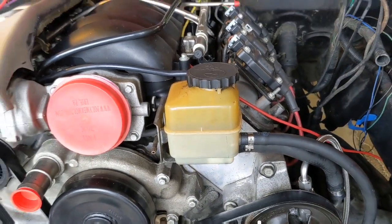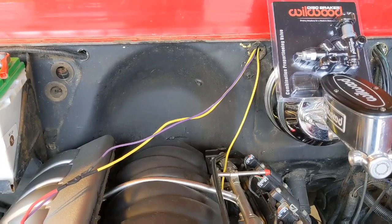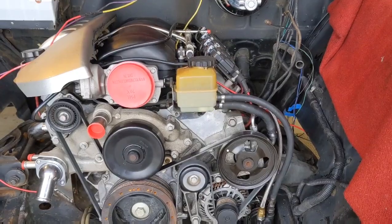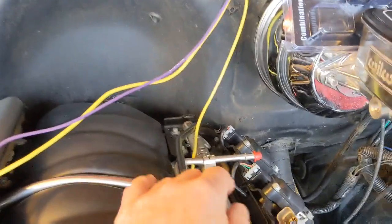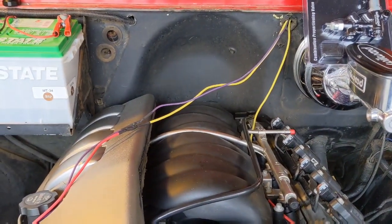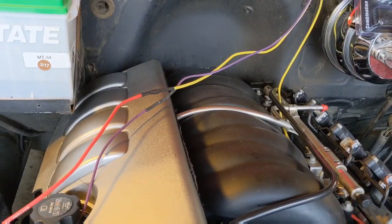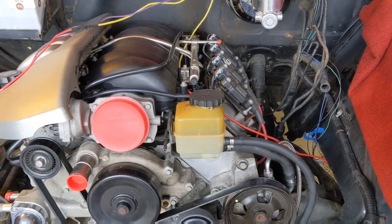We've rummaged through the wiring and you end up with two or three circuits. In this particular situation we have the starter on the passenger side and the alternator on the driver's side. Since we're using the Ron Francis wiring, they actually have two circuits — one for the alternator and one for the starter. They're the same circuit, and if you have an alternator on the passenger side they can run together, with the positive lead off your battery going to the starter and then to the main fuse panel, with the alternator connecting to it.